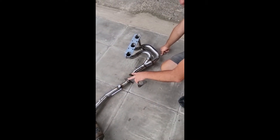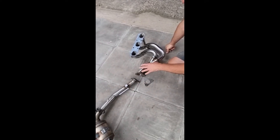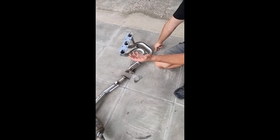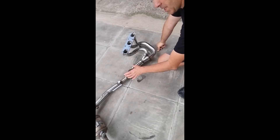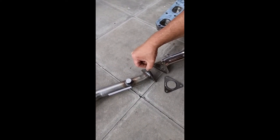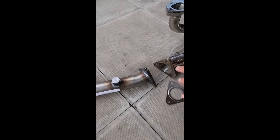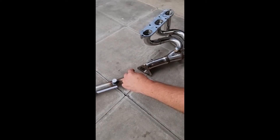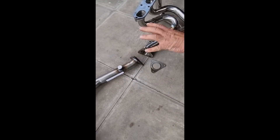This joint is notoriously difficult to undo. Removing the cat from a standard header or manifold is quite difficult because these studs, as you'll see in a moment when we look at the car in real terms, are very rusty and you can hardly see the nuts and bolts themselves. The standard practice is to cut a slot in them, like this one here already has, so that when you try and take them apart it takes the pressure off the rusted stud and enables you to break the manifold and the front pipe away from each other. If you're having trouble getting the studs out even with the nuts off, cut a little slot in and that will enable you to drive the stud out and then separate the pipes easily.